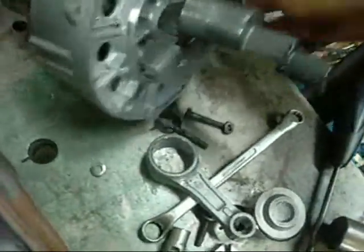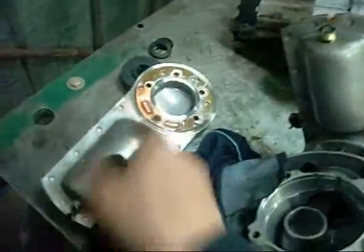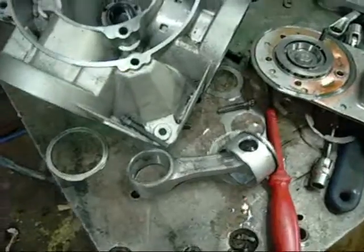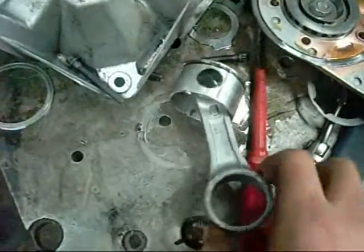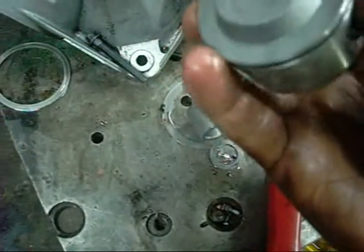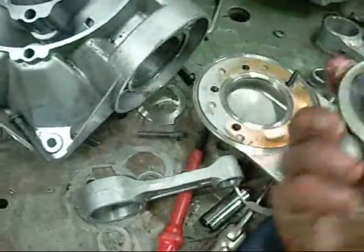But that was the main source of pain. The top and bottom bearings would have seized up. Muffler. Oil. The other side is the same — noticeable wear, a lot of black oil on everything from the aluminum coming off, but nothing too serious. Nicely run in but that's about it. Single piston ring obviously. Good bores, nicely run in. That's about it.